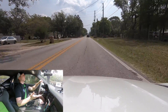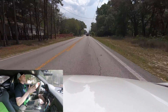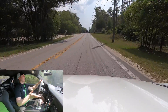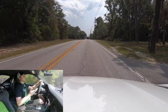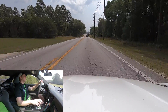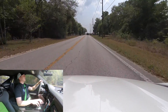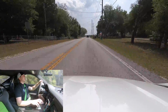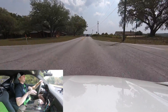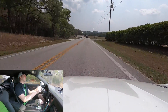I'll lower the front as low as I can go. The RS has a wider 265 front tire instead of the GT3's 245, so we don't have as much room to lower the car — otherwise you start rubbing. I'll lower a little bit and play with it to see what I can get without rubbing. I've gone with a more aggressive camber setup on the lower suspension and just didn't like it as much.